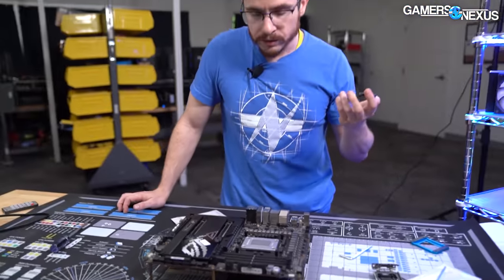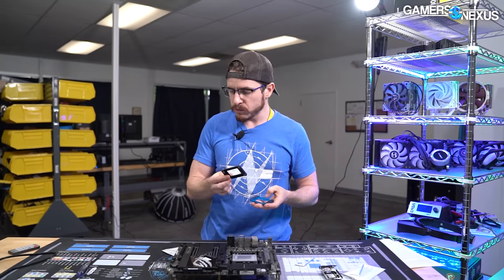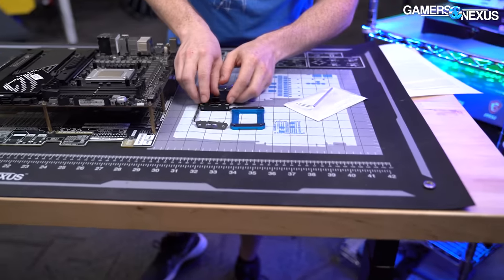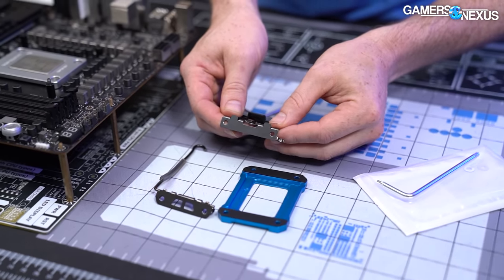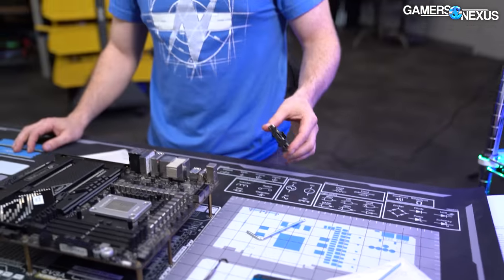The frame is now installed and you're ready to install your cooler. I wasn't as big a fan of the washer adhesion solution compared to the Thermal Right solution — you get more surface area with the Thermal Right, you don't have to adhere it yourself, and it more accurately mimics what the stock ILM does for surface area on top of the motherboard. That pressure from the screws is more evenly distributed across a larger surface, which makes it harder to damage the motherboard.